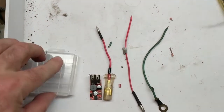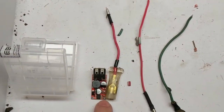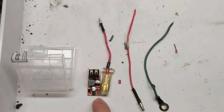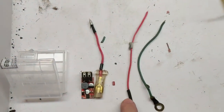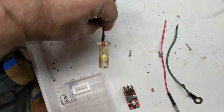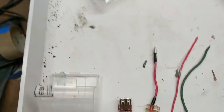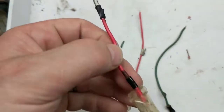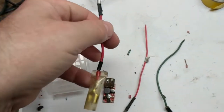This is just a box that I'm going to put everything in so that it's somewhat water sealed. Basically all you need to do with this is make a positive and a negative connection. The negative needs to go to ground on the bike. The positive should go to anything that is hot when the ignition switch is turned on — on my CT90 that's a red wire. The red wire comes back from the ignition key and splits off, so you could just tap into a red wire anywhere you see one.